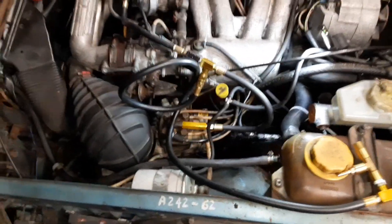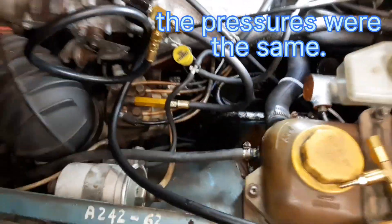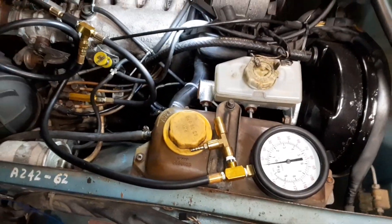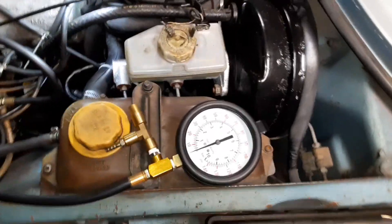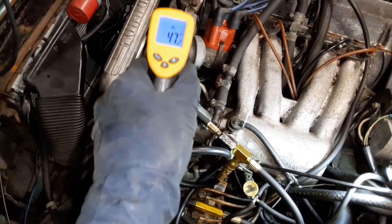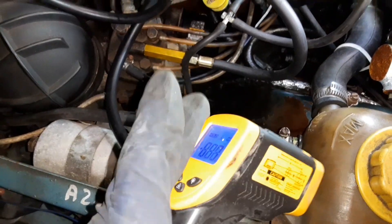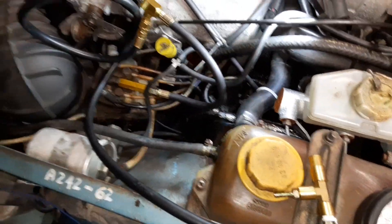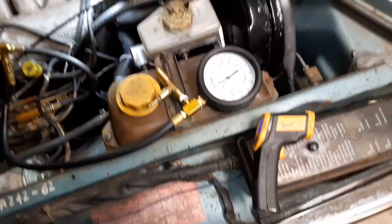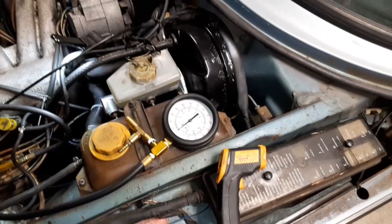I'm back and I'm going to fire this up again and do a pressure test from cold. Right now we're at about 45 degrees in the garage, and the warm-up regulator is sitting at about 47 degrees. I changed the adapters around a little bit, so hopefully no leaks. I'm going to start it up and go with the pressure right from the get-go, then track the temperatures at the warm-up regulator as we warm up.